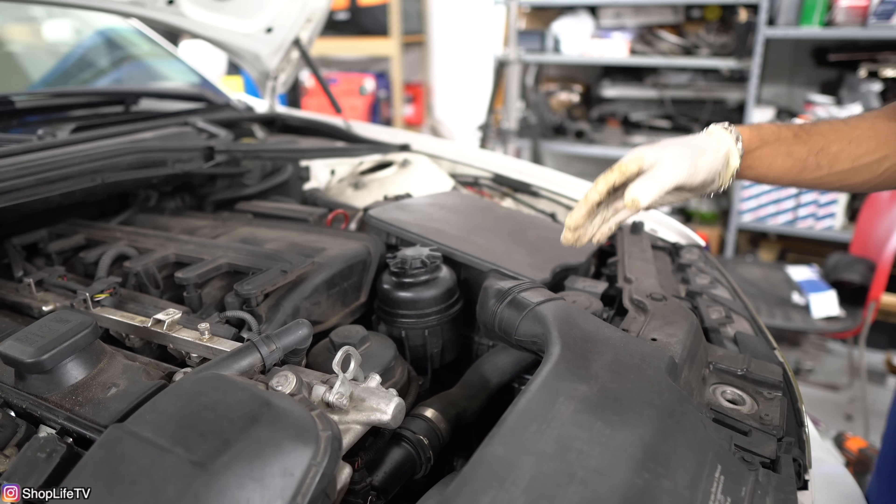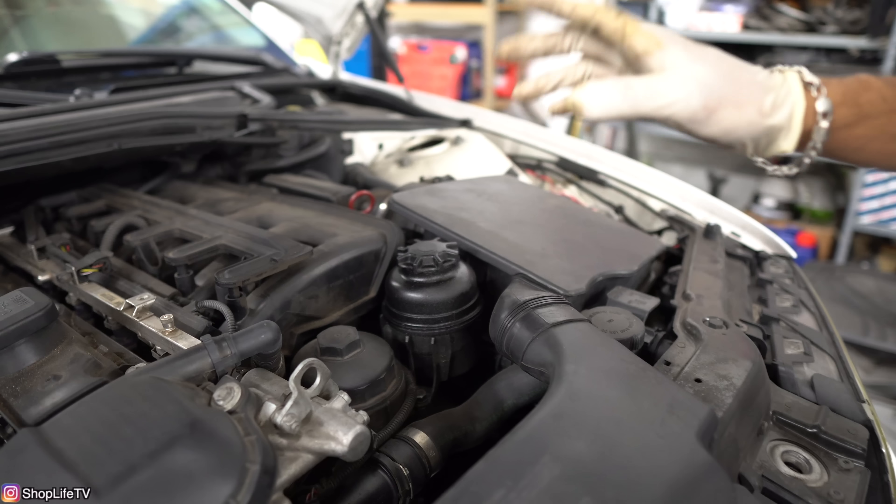We will have to remove the whole tray, but before you do this, you do have to drain all of your oil because that sensor is at the lowest part of the pan. We're going to start out by loosening the oil filter housing so that most of the oil starts draining back into the pan before we remove the drain plug.